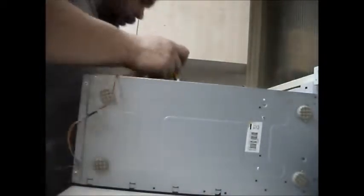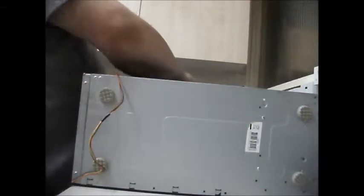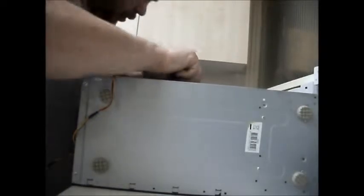I'm not sure if I brought it through. Yeah, I did. I've got my little flash drive with the drivers on. So I can actually get this up and running properly and then upgrade the video card if I so wish afterwards. But I do have the LAN driver and the audio driver and the VGA driver for the board as well. I've never really bothered downloading BIOS drivers or anything like that, because I've never really needed them. All the computers I've done have worked fine without them. So I don't know if anyone else has got the same opinion there, if it's necessary or not.